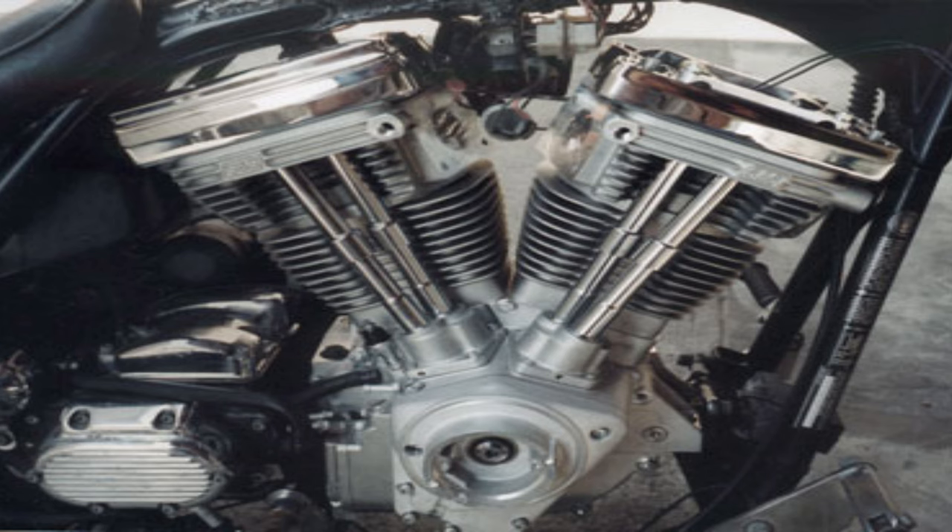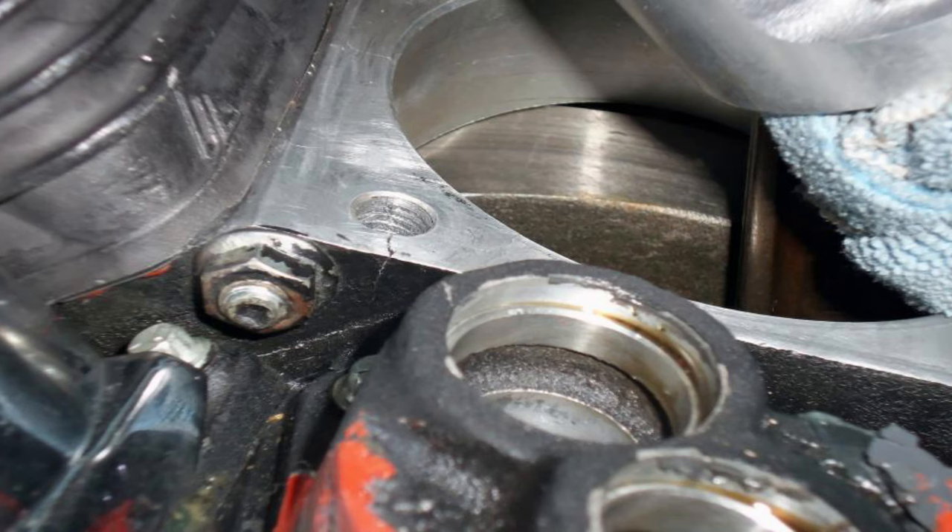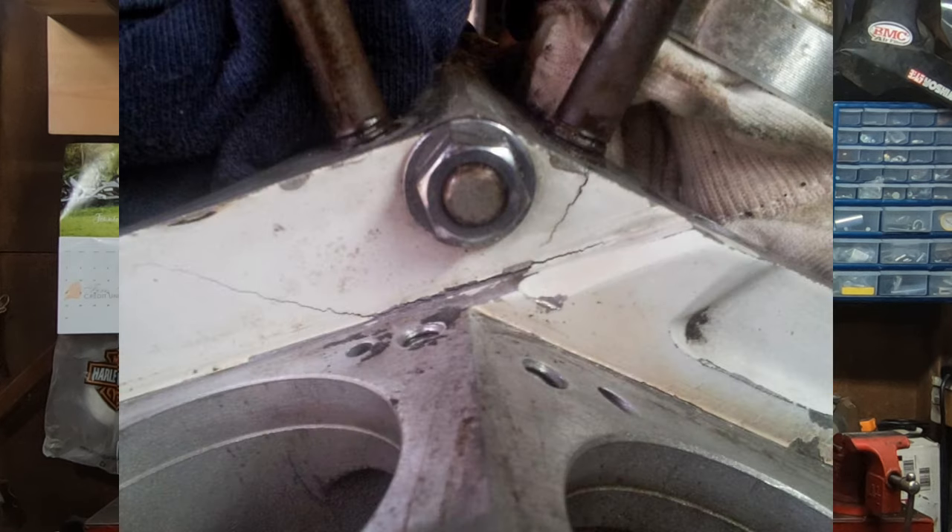Which allowed the aftermarket to build basically clones of the Evo with the factory defects engineered out. So you can get an extremely powerful Evo engine that's not going to crack the cases or pull the studs right out of the cases. Some of the common problems with Evo engines when you're really trying to put some power into them: number one, the cylinder stud spacing — they were really close together. When you start trying to put some high compression into them, sometimes those cylinder studs start to try to pull out of the cases. Also, with more power, the Evo would sometimes tend to overheat because of the lack of fins on the cylinder. And in some model years, they actually had issues with the cases themselves due to the castings — they would actually crack when you really started to try to put high horsepower into these motors.